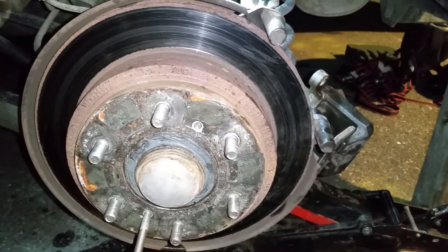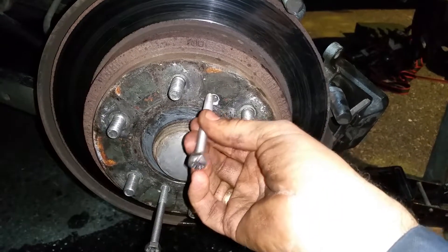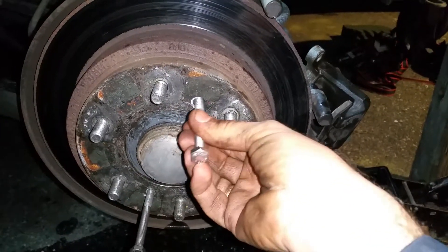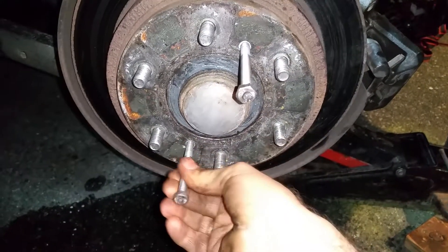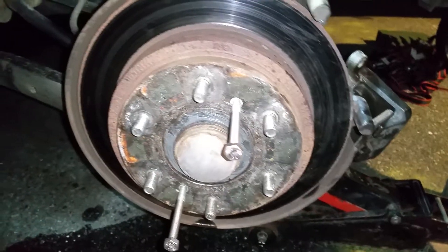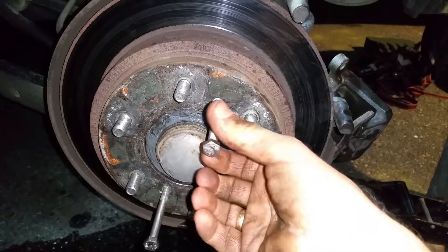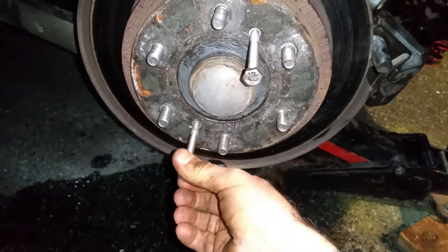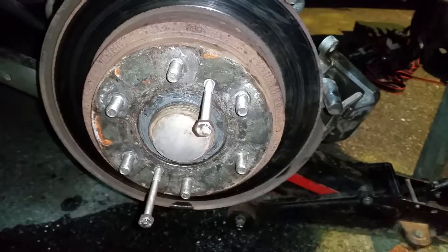So I told him: you have to use these holes that are made by the manufacturer. On most cars you will find these holes in different sizes — in this case it's M8 bolt size. Use some anti-seize grease, preferably the copper type, to prevent rust forming in the hole. Put these bolts into both holes. First, of course, you take the wheel out with the car jacked up and supported. Then you'll most likely encounter some resistance, so use a socket wrench and tighten one bolt at a time — don't work on one side only or you may break stuff inside the wheel system.